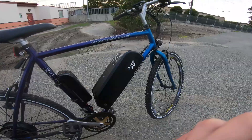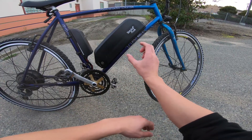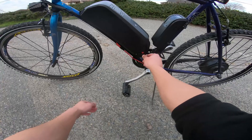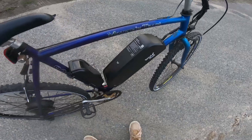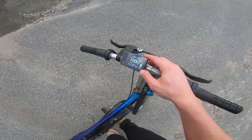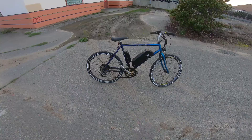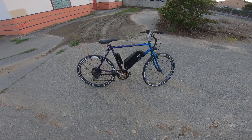This is my review of the Simple Plus battery. What I liked most about it was the simplicity of the install — there's a bracket that just bolts onto the bike frame at the water bottle mounts, and then you slide the battery on and lock it. For the connector, it comes with an Anderson connector and I had to use an adapter to convert from Anderson to XT60. It's nice that it has an on/off switch and a charging port, and the battery fits in between the frame. It has a Samsung battery. So far I've ridden 13% of the battery and gotten 3.4 miles, so at this rate I'm going to get around 22–23 miles when it's at 0%, and I've been riding quite aggressively. The hub I have is a 26-inch 500-watt rear Bafang hub motor, and if you want to see that install, I have a video for it in the description section below.